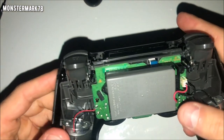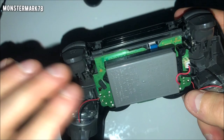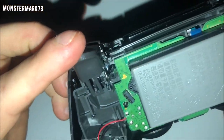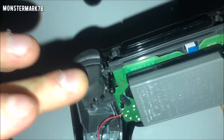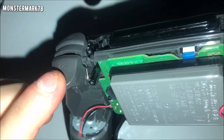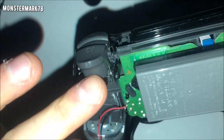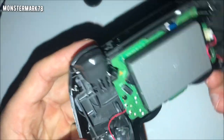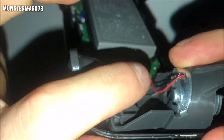Next is visually inspecting the R2 button before you actually move the battery or take the green chip out with the spring. Check that the button is moving and nothing is loose or broken, because sometimes you can just tell by looking that it's a plastic piece that snapped and needs replacing. You can see the little spring on the side — I'll show you how to replace that shortly. Visually inspect everything first.